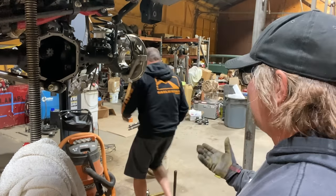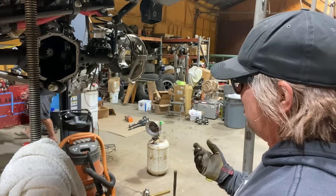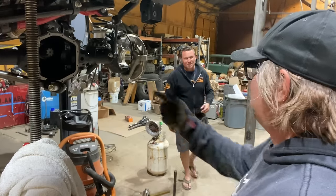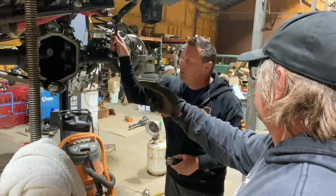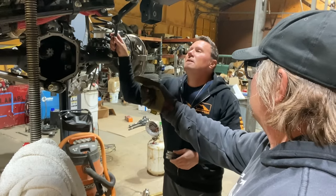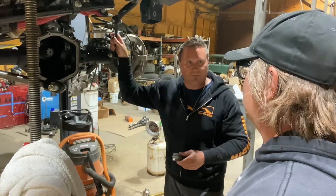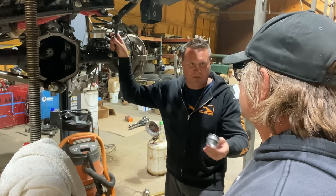But you couldn't measure your crush sleeve and then measure your new one and be like, just crush it down to that. No. Because it's just different variances. Well, and plus we have that spacer in there. Which spacer? That shim we put behind that. So if anything, that would make it bigger. Yeah. So that's perfect. Perfect reason why you can't do that. I never even considered it, so I didn't even think about it.